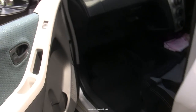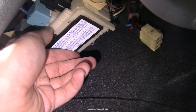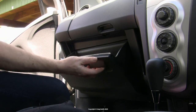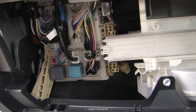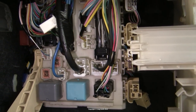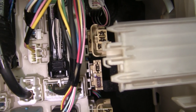The interior fuse box on the Yaris is on the left side of the car in the footwell. You can access the main fuse panel without removing any of the dashboard; there's just a flap cover that pulls off. On this right-hand drive car it's below the glove box, which I took out so I could see the extra bits and pieces placed awkwardly above the main fuses. Normally I would use fuse taps to get power for any accessory, but this was the first challenge — the plastic cover precludes their use because they stick out too much.